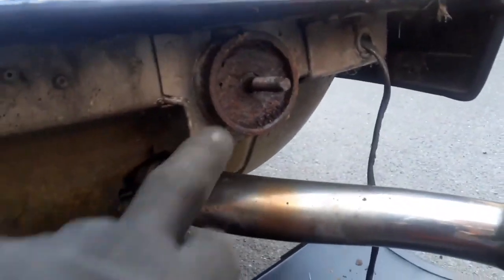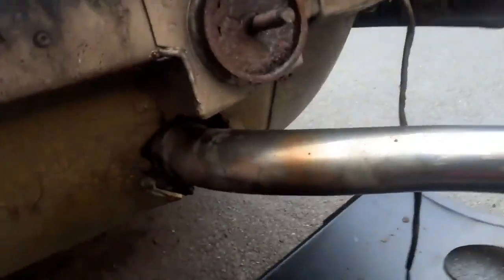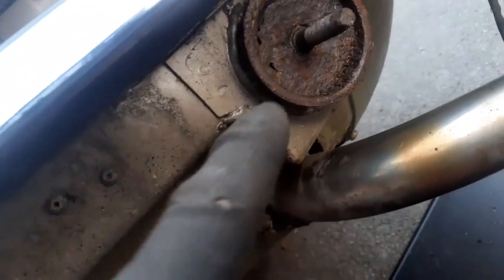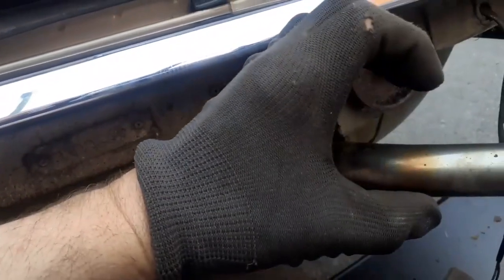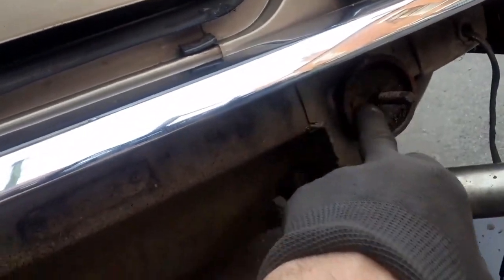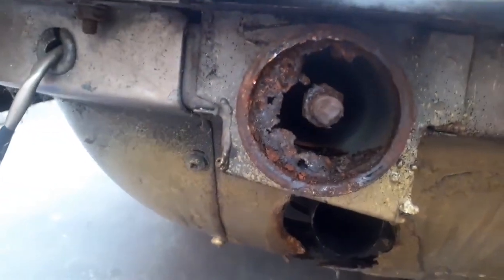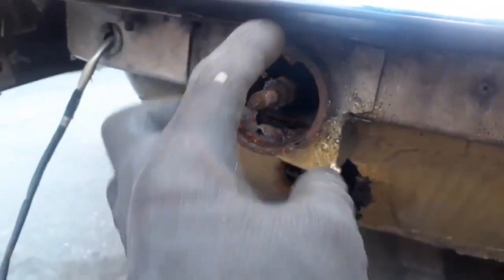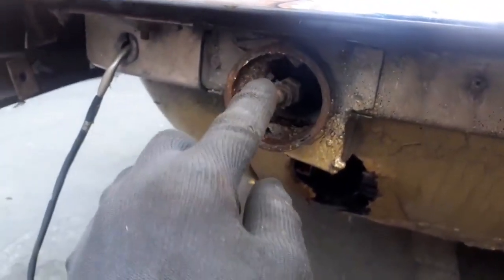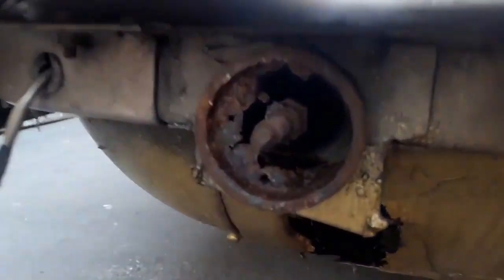It's supposed to look more like this. This is obviously the bumper mounting, but there is rust there. Let's get the light on it. There is rust, so I'll knock all that out. I'll trim it out, and I'll make a disc with a hole in it, just the right size, and weld that in place. So that'll have all new metal. Where there isn't any metal, it'll be easy. Just cut a circle, drill a hole, and I'll just oxyacetylene that in. It'll be an easy enough job.